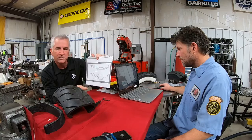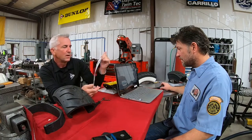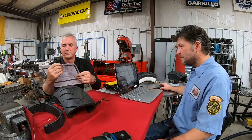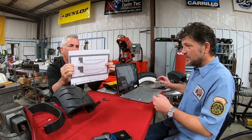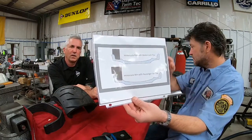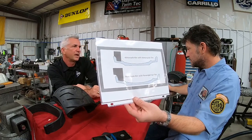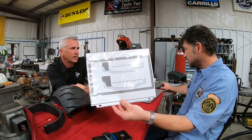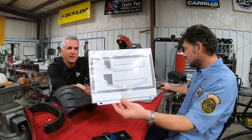The bead flange is also higher on a motorcycle wheel. With that said, when you marry the two, the top diagram shows the proper fit — a motorcycle tire applied to a motorcycle wheel and that marriage is pretty tight. When you mount a passenger tire on a motorcycle wheel, that marriage is somewhat separated.